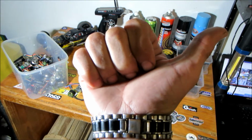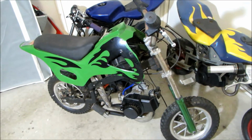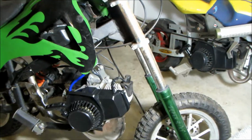Back to trying to start the off-road pocket dirt bike. I haven't touched the pocket dirt bike since the last video. If you haven't seen that, go down to the channel and check it out. I guess the first thing we'll do is check the spark. Make sure the coil's working and the spark plug's good.